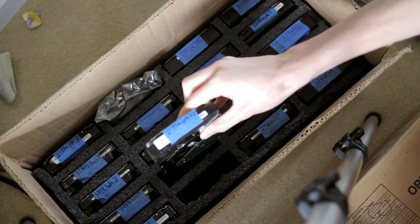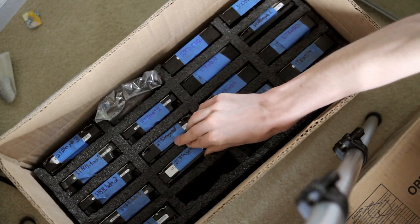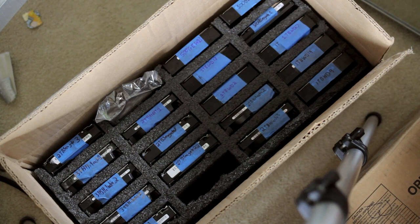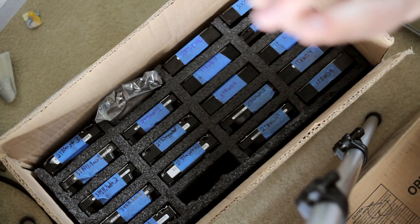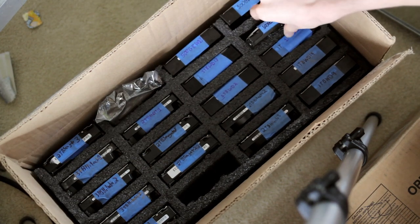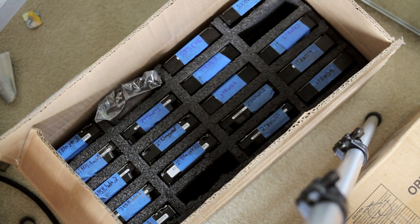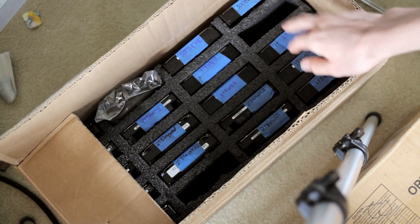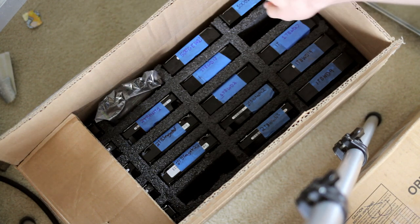I have a lot of 2TB and 3TB drives. A lot of these 2TB drives are Seagate video drives, which are fine, but the problem is they don't work in most NAS boxes I have. I think they require a SATA signal from the system to start up — something intended for video DVR boxes. They work in almost all desktops, they just don't work in server NAS boxes. Similarly, I think these 1TB WD Green drives for video use have the same issue.